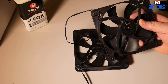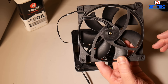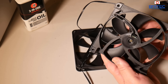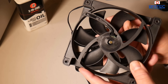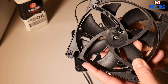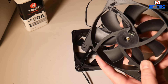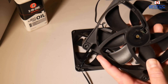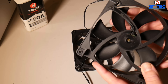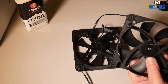That's going to allow you to get access to the back of the spindle inside, where you can then put on some grease or some oil. If you don't want to take it apart, you don't have to — you can try to put the oil in there without taking it apart. Don't overfill these. You should see a little washer inside there, and you can lift that off. This is generally what causes the squealing or the noise. You can put a little dab of grease in there if you want. If it's dirty you may want to clean it right out, but if it's clean you can just add a bit of oil.